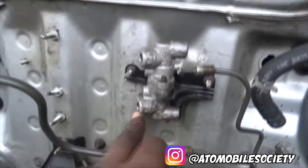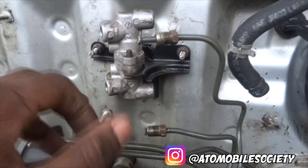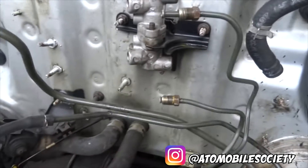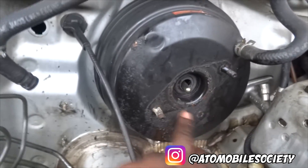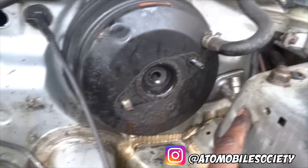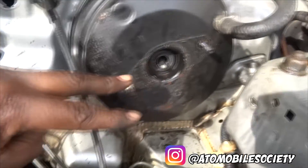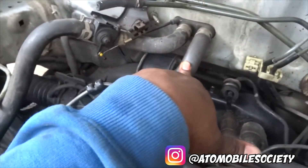For the proportional valve, I'm not really going to do a brake tuck — I'm just going to neaten these lines up. I'm going to get some different lines; I think I'm going to make copper lines, some nice lines with a double flare, so I'll get a double flare tool and do that. I already have the schematic out so I know where they go — the master goes here, the lines are on the tower side. If I can pick up a Civic Si or EK booster with the lines facing this way it would be much easier. For the heater hose, I'm going to get some K-Tune heater hose.